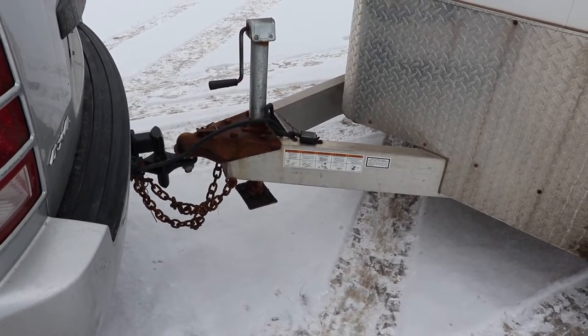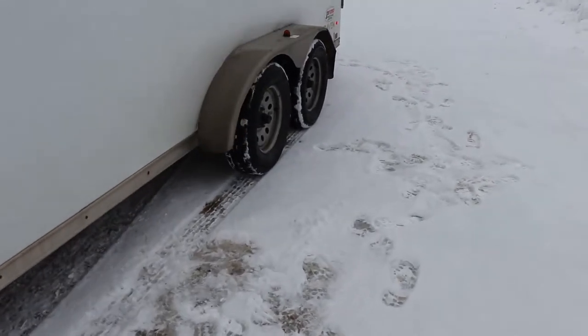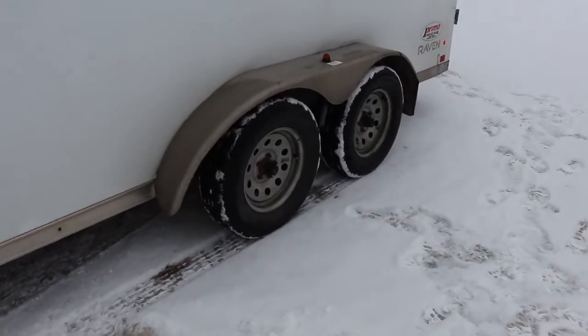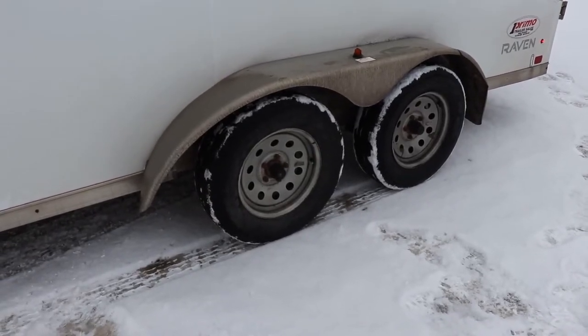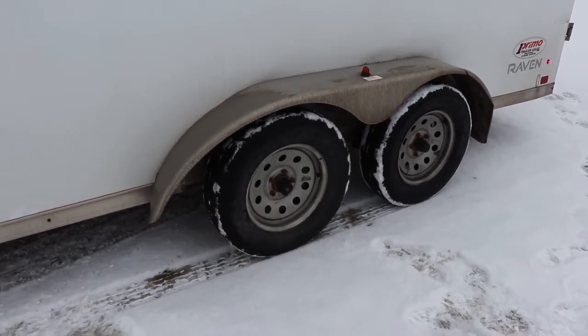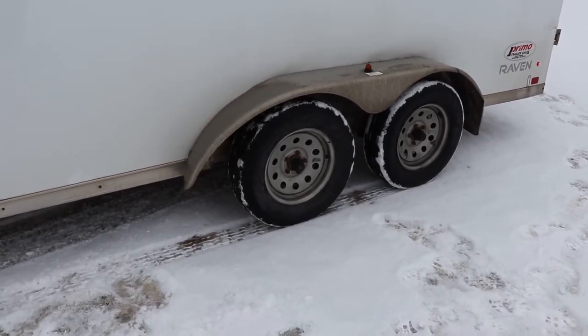You might be wondering where the battery is for the emergency brakes. We'll see that in a minute. This has brakes on both axles — I haven't looked to verify but they pull nicely when you're using the brake controller. It's like a parachute even when you're unloaded; you can kick up the gain so it pulls you back.